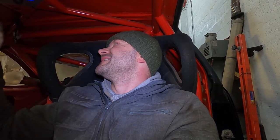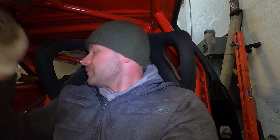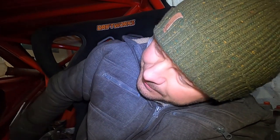When the diesel is cold and you got a lot of fuel from the mechanical pump, that's normal. Once it's nice and hot, it clears. There's no more white smoke, it's gonna be black. That's unburned diesel. Now, power is off. And yeah, I think we're good to go home today. I'll see you soon.